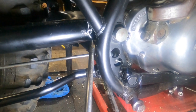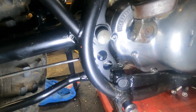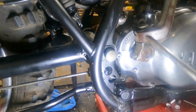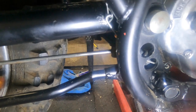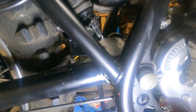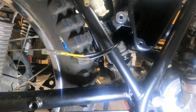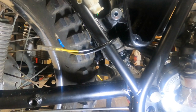All right. Now, this wire, obviously, you can tell, has a bend in it. Okay. That has to be behind this bolt here, the swing arm bolt, and it comes down inside and hooks into there. When you put the brake on, it pulls that, and you can see it pulls the plunger, which is here, on the brake switch. Now, to make sure that we got rear brake lights, what we're going to do is hook a test light to this and operate the brake. Then if we need to make adjustments, we can go ahead and do that. So I'll be back.